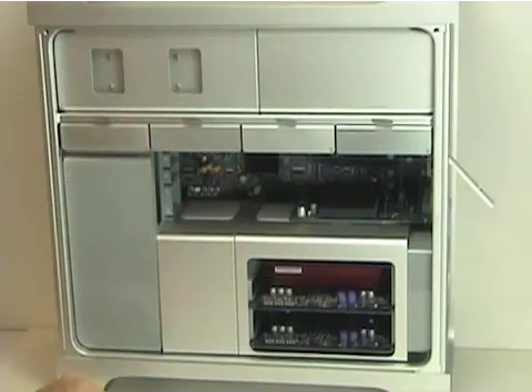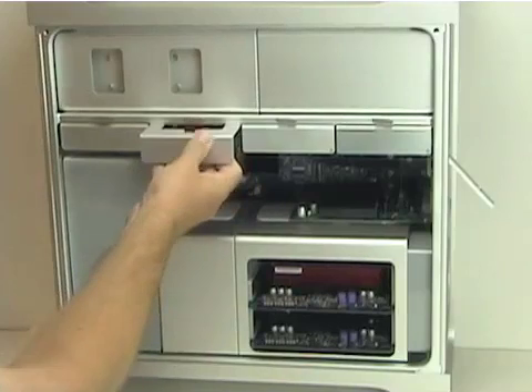One is already populated from Apple with a hard drive. You can install any Serial ATA — Serial ATA2 actually — hard drive. Factory units have been Hitachi and Seagate to this point.